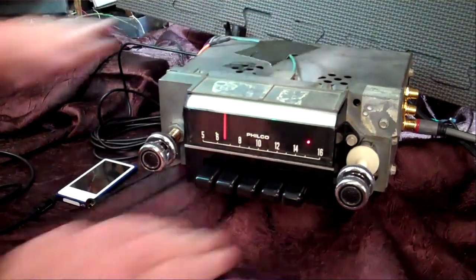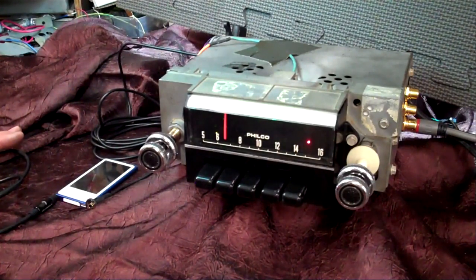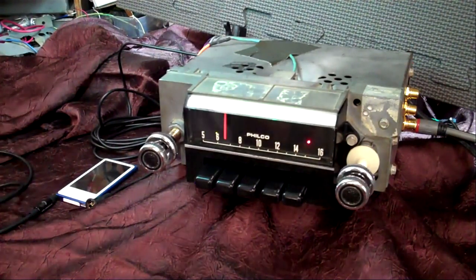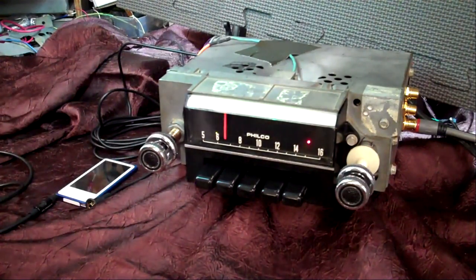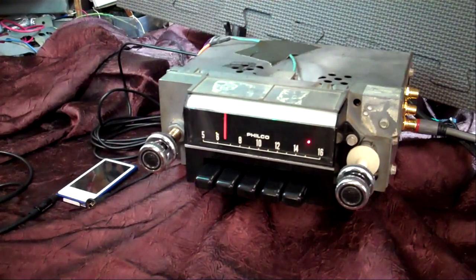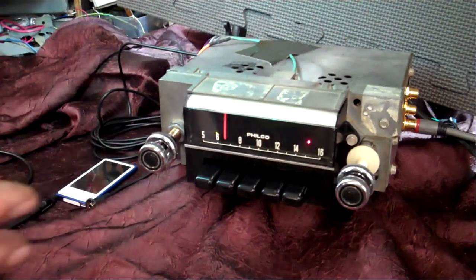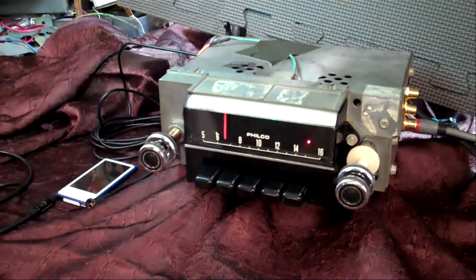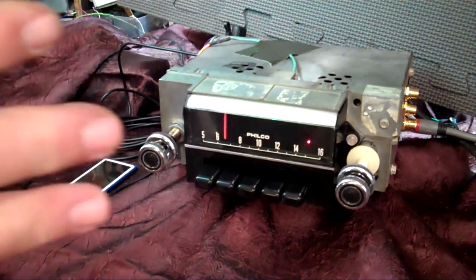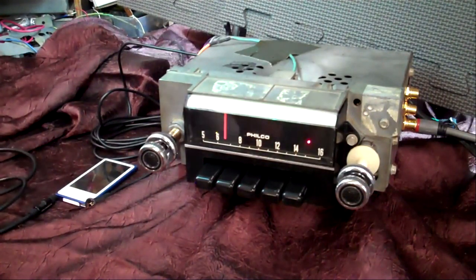We're back to the Mustang Connection radio, out of California. This is their original 1969 - it's got matching numbers on it, it's a 69 model, it's a Philco. We've done a basic Aurora design conversion on it. I had three other videos on it where we tore it down, cleaned everything up, polished everything, and now we're back to the finished product. Right now you have AM FM stereo with auxiliary in, four channels out, 45 watts a channel, and it also has five pre-outs on it. You can add an amp to each of your speakers if you want to power it up more, and also you can add a sub. There are little flat subs out now - they're absolutely fantastic, you can hide them anywhere, and it really pumps the radio up and makes it sound good.